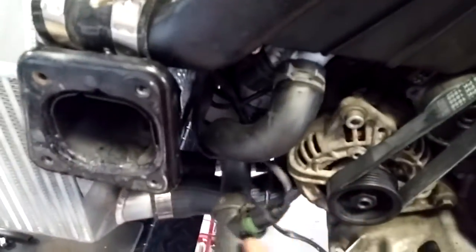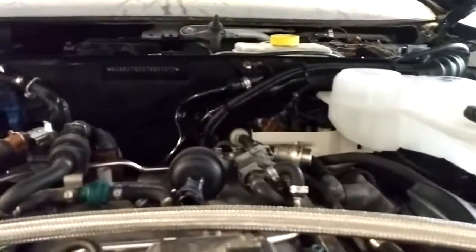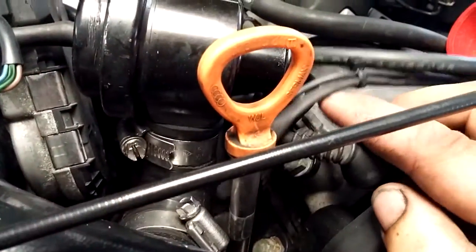I'm going to lower this a little bit here and just kind of show the top. One sec. So looking at the top here, as I was saying, this the coolant fan switch, I have added wiring right in, and it kind of goes right into the main harness here. Hard to see with the poor lighting in here, but let me see if I can fix that. All right, got a little better light. So anyways, that coolant switch runs through the harness here. I also ran into the harness the additional wiring for the AC compressor, which on the B5 and C5 chassis, runs through the body, not through the engine.